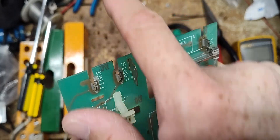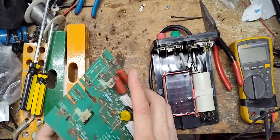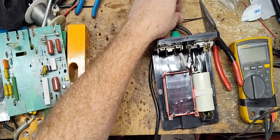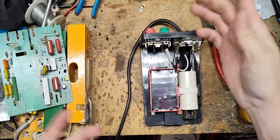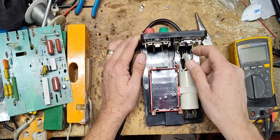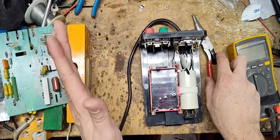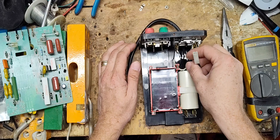Since this wire plugs in right there, it's so close that lightning would hopefully jump from the fence to the ground. If it didn't dissipate through the ground rod, it would hit this and go to the neutral side of the AC — which, on the electric side of things as wired in a house, the neutral side is like a grounded hot. That's how I'd explain it. I'm not an electrician by any means — more of a technician than an electrician.